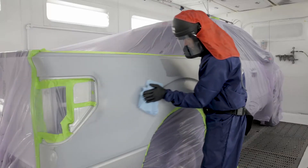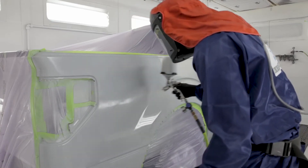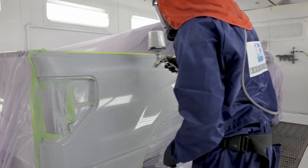Tack off the entire repair area. For spot repairs, adjust the spray gun pattern for the size of the repair. Note that application of primer sealer for solvent paint versus waterborne paint may have slight differences.